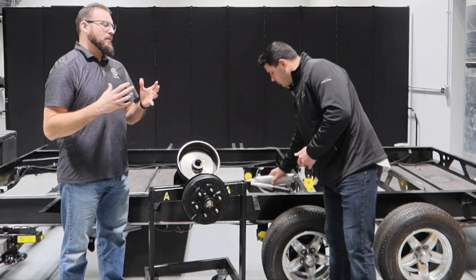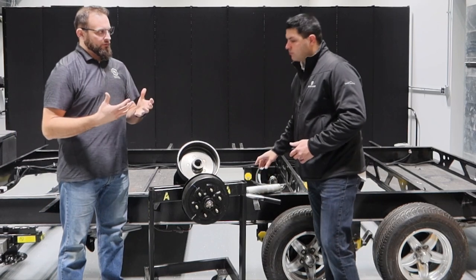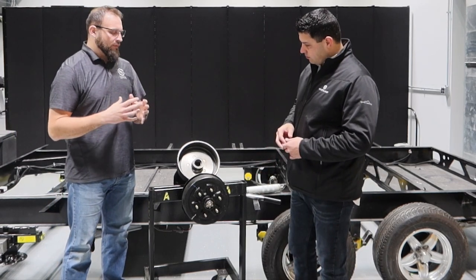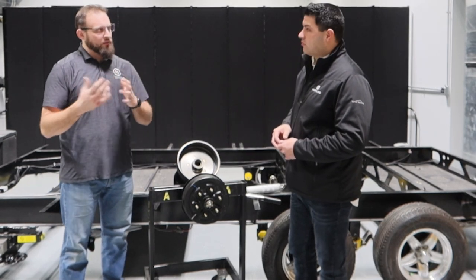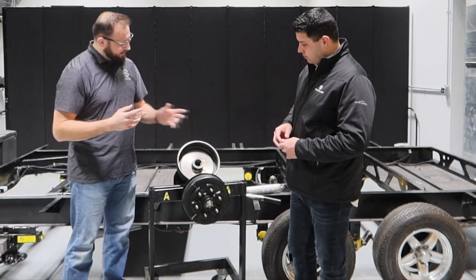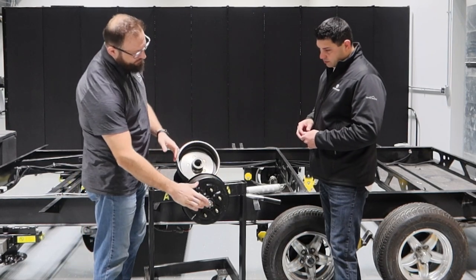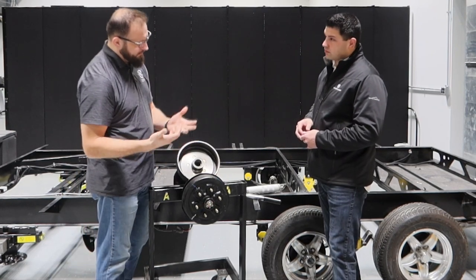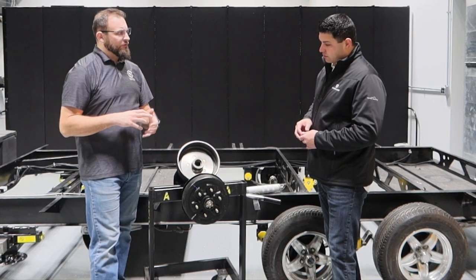Your service would still want to be performed every 12 months or 36,000 miles. Grease can go bad just over those time spans, so what we're going to do with the grease gun is give it one or two pumps — we're just trying to get some fresh grease in there so we can get it in for service.